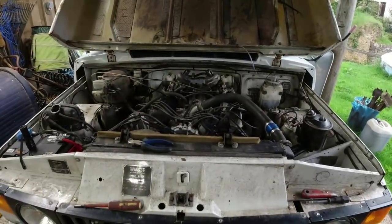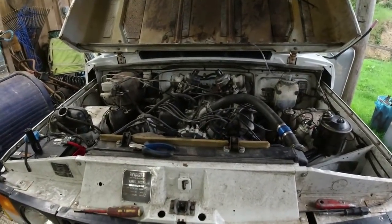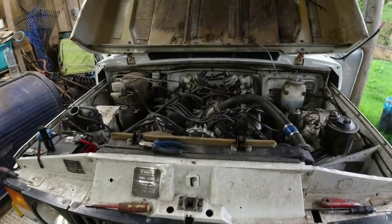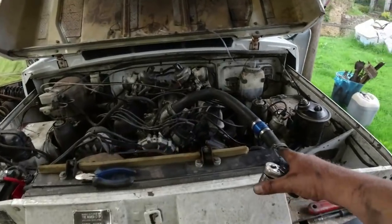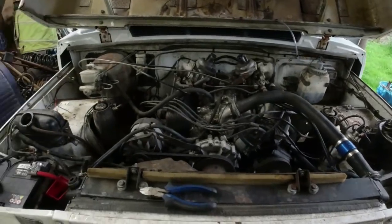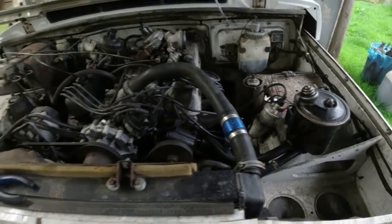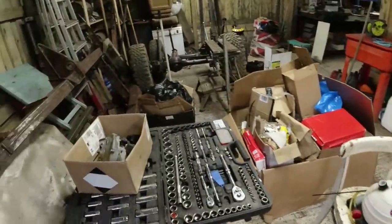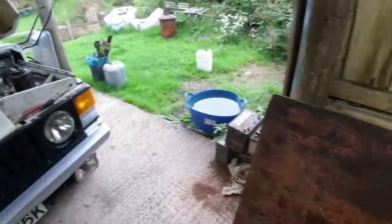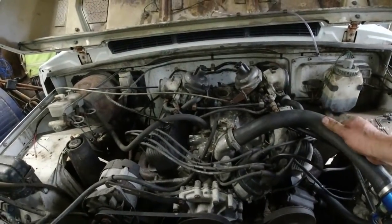Right. I think now we've done that, I'm going to start working around the electricals in this engine bay, so I can test or get the fans up and running, check they work. Because in theory, if I connect those two terminals together, then I will be able to confirm, first of all, the electric circuit's okay. Then, of course, I'm going to need to test the thermostatic switch, which is in there. We can do that. Oh, not bad. Bad for a couple of hours' work. 2.5 hours, that.